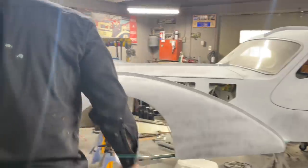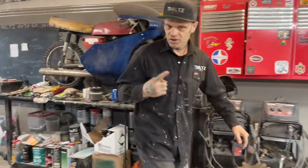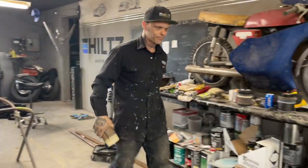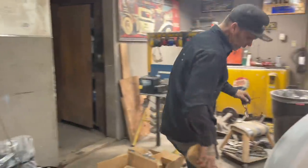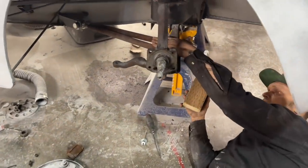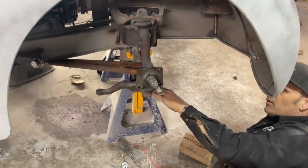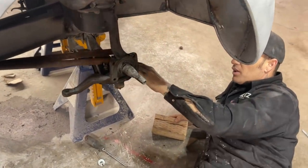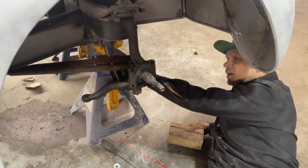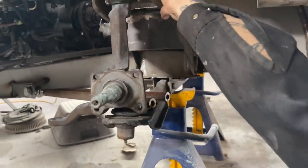The radius arms are really making me happy the more I think about it. This is just for suspension, just to hold it in place. What I've got going on here is this arm is only going up and down. With the two inches of travel it's going to have, it might pivot a little bit, but that's what it is. That's what the factory front end is that I've made. The arm on the bottom is a factory piece, but the top arm is a factory piece that I have modified—I made a video about it.